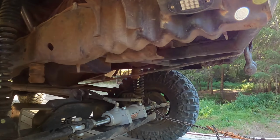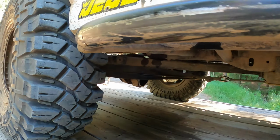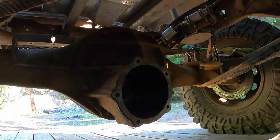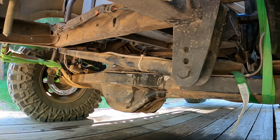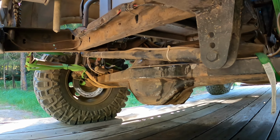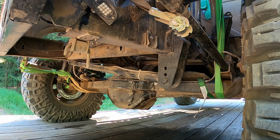Jonathan's Bronco got the winch cable holding up, holding forward the rear axle, and had to take the pinion out. It's just the ring gear now. This is all binding up and everything, and just wasn't good, so I had to pull that out. But the track bar held up, which is actually really good. The Heim joints helped keep them from breaking. But yeah, we got real lucky with this one. We were able to make it back to camp and not be stranded out there.